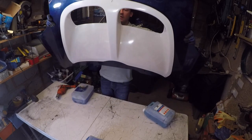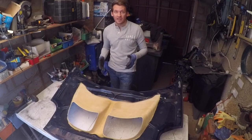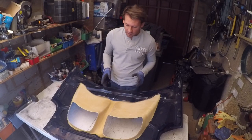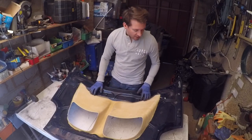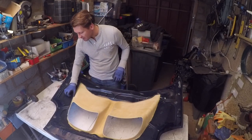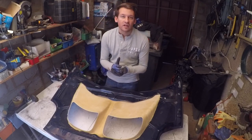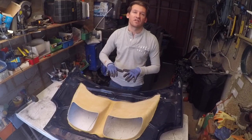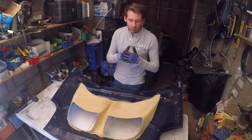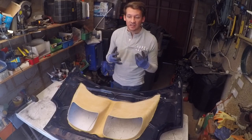That will allow me to have guiding holes for the rivet holes when I come around to drilling those, once I've decided what size they'll be and what rivets I'm going to use. But for now, I can go around the inside and see everywhere that the mould, the part, is pressing against the bonnet so that it's not going to sit flush and it's creating a pressure from the back. That's going to be a problem when I bond it. If that's pushing away or helping it lift in any way, that's going to prevent it from actually bonding together.